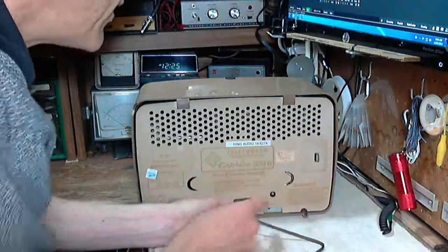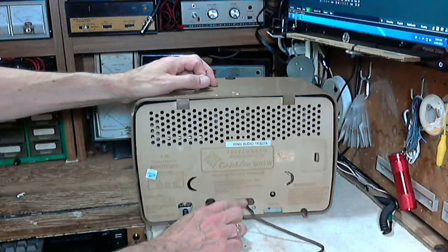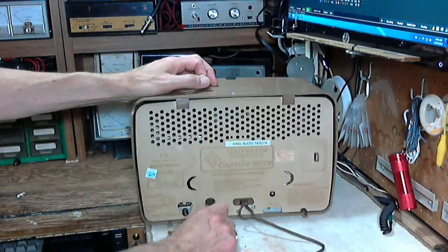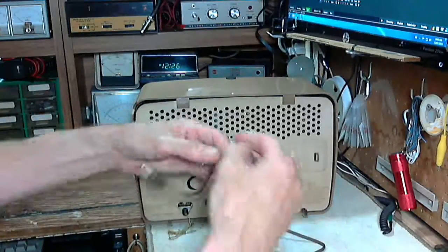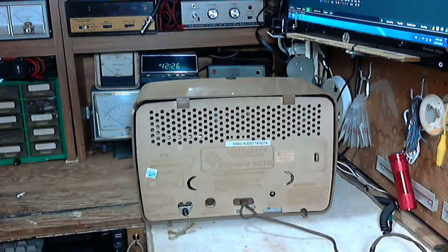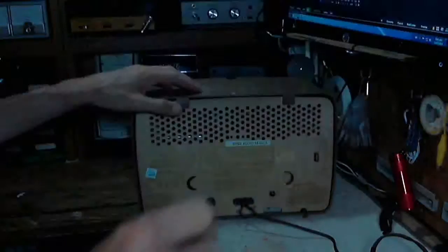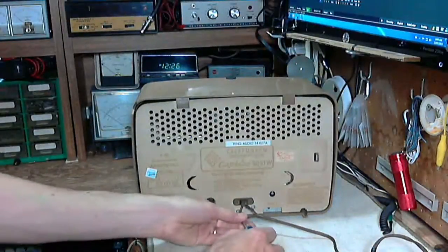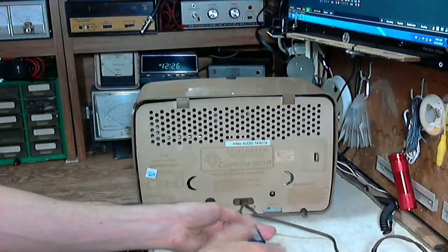We might be able to make it safe enough for operation here in the shop, but you know what? It's a piece of crap — it's got to go. I'm almost embarrassed I operated this in the big shop for a few minutes. Another spot these cords give out is right up in here at the plug. This one's okay, but the plastic is stiff, which means it's on its way to cracking and failing. So this cord is really not of much use. That's the opening salvo on this radio. Let's take the back off and then we can put on a temporary cord. My usual cheater cord for these — I think I let it go with another radio. I think it's gone, so I'll have to do something else.